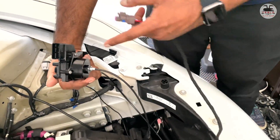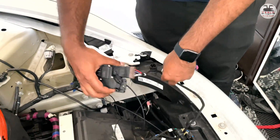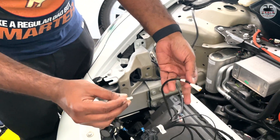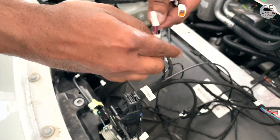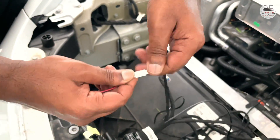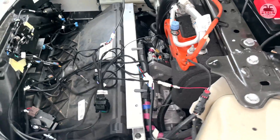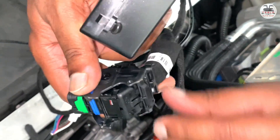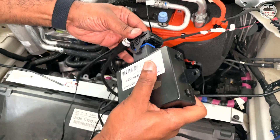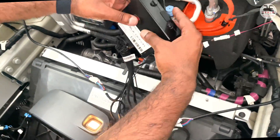To plug the lock motor, there is a brown plug in the daddy cable — attach that to the motor hub. It clicks into position, very straightforward. For the large mega plug that goes into the controller, it has a swiveling lock on top. Push the lock all the way down, push the plug into the controller until it locks in position, then push the lock back up to secure it at the top.